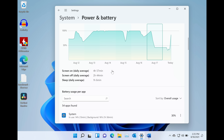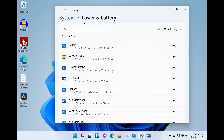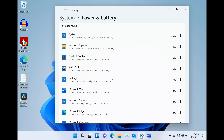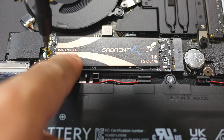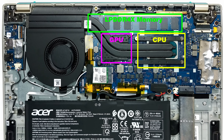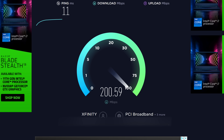The included four-cell 55 Wh battery lasted 9.1 hours on a single charge on the balanced power profile, which consisted of about 4.8 hours of active work time in Word, Excel, and Photoshop, and about 4.3 hours in sleep mode. I noticed about a 1.5% drop per hour in sleep mode with Word and Photoshop open. The battery took 1 hour 48 minutes to fully charge while the laptop was in use. Battery life is one of the trade-offs you make with socketed components — soldered LPDDR4 memory is significantly more efficient, but of course isn't serviceable. I had zero issues with connectivity; the Intel Wi-Fi 6 Bluetooth 5.2 module delivered fast, consistent, and unimpeded data.